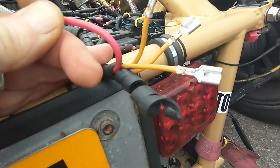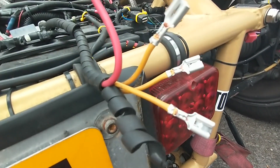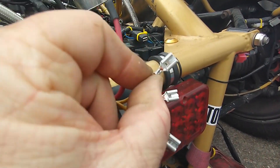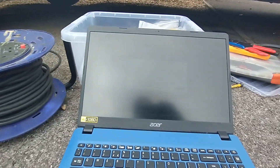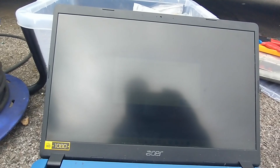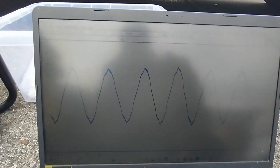These are the three wires that come off the — I think you'd call it an alternator on a bike. It's basically off the coils that are on the end of the crank. So we will see AC on these. That is the battery one. First I'm going to do is just — I've got an oscilloscope on my laptop, which hopefully I'll sort out a way of being able to see on here. And we'll have a look at what goes on. So, that's off the one channel down to earth.